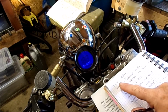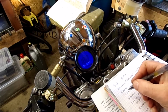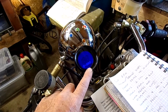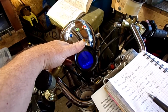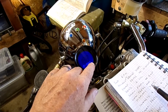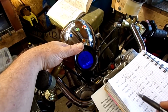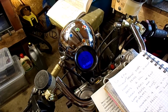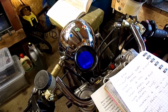Right, so now short press, set RPM, following the above steps. Short press to display 2-002, which is for a 2-cylinder, which is what I want. If you wanted a 4-cylinder, you do a long press to get this 2 to flash, and then you can change that to a 4. But we don't want to keep it on that, so it will be a short press to skip, which takes us to 3-002, which is a 2-wire meter, which is what I want.